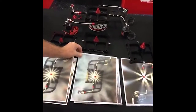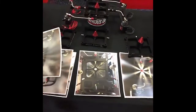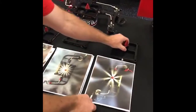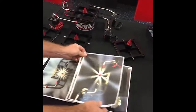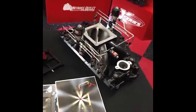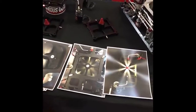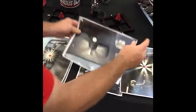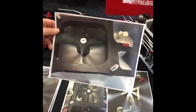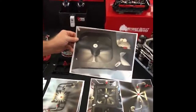Let's look at the Stinger 2 — flipped over. You can see it has a little bit more discharge, so there's more break-up inside the intake runner. Stinger 3 — if you look between these two discharges, you see a big difference. Stinger 3 on this intake, you can notice it kind of blows right down the runner. On shorter intakes it moves the discharge further down. Over on a tall intake, you can see the frosting right at the top of the runner — it's actually collecting exactly where we want it to. So for you guys with the tall Qi intakes, this is it.